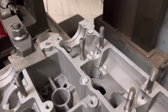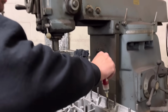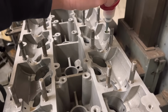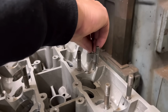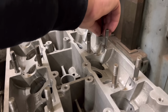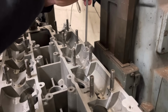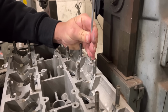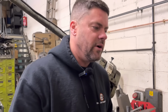They bottomed out. And I'm putting them in with a 648 Loctite. Proper sticky stuff. So I put it on the thread inside there. Look, plenty of the old goop. This is where you're on camera and it didn't start to thread in. So we just go down to there. That's it. So we'll let that go off.